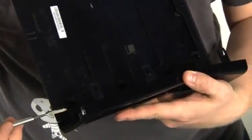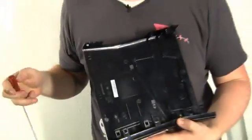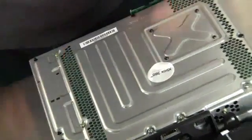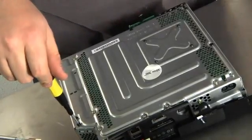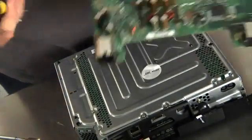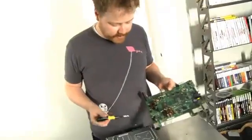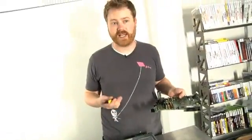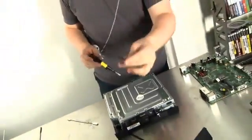You need to release these little clamps on both sides — you have to jam a really long screwdriver down this groove in the plastic wedge from both ends and it'll just pop off. The black screws look like they go all the way through and hold the motherboard onto the chassis. Interestingly, this is the back of the heat sink. One of the things that makes the Valhalla Xbox 360S different is that instead of having two separate chips — a GPU and a CPU — the Valhalla design puts both chips under one heat sink fan.